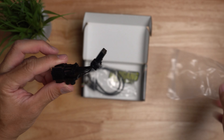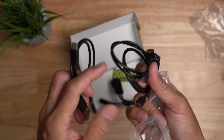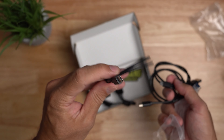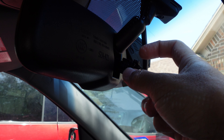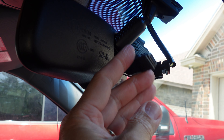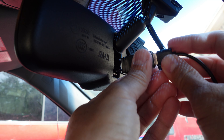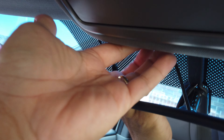Thank you Dongar for sending this adapter. It comes with the adapter itself and short USB cables — micro USB, mini USB, and the USB Type-C that I'll use. Note that most rear view mirrors are only powered when your car is on, so this is not a replacement for hard wiring your dash cam. Just pop off the wiring from your rear view mirror, insert the male end of the adapter to the mirror, insert your car's wiring to the other end, plug in the short USB-C cable, and connect the other end to your dash cam. A bit of cable management and that's it.